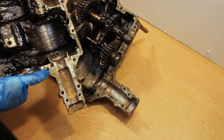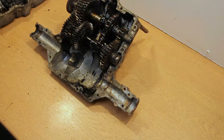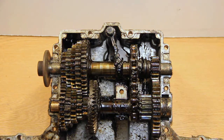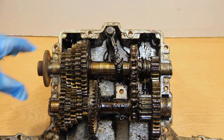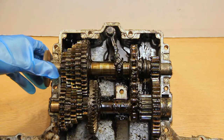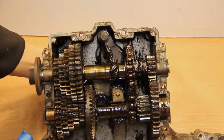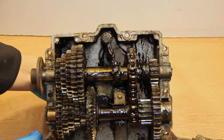It's got plenty of grease in here and it looks to be in fairly good shape - not with any metal shavings or anything. The other side looks quite good as well and it looks like these gears have got a fair amount of life left in them. I recommend putting some disposable gloves on when you're inside these gearboxes because they're so greasy. I'm not going to take any of this out yet because I don't actually know what needs replacing. I'm going to inspect all the gears by turning the input shaft on the other side, which will turn all these gears round, and look at each tooth on each gear to make sure none have snapped off or worn out.